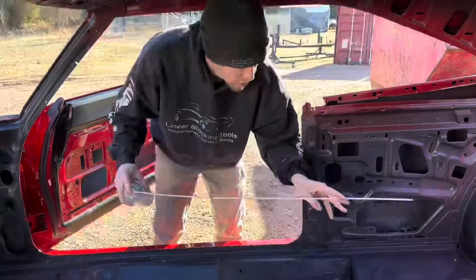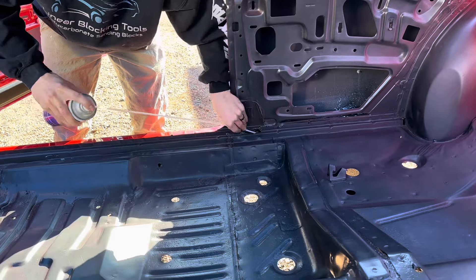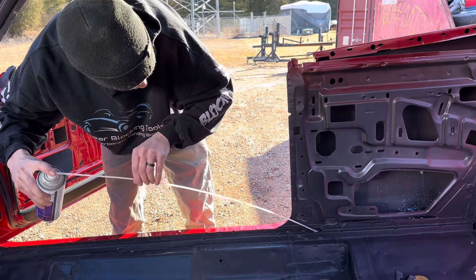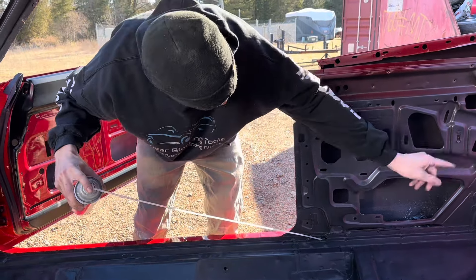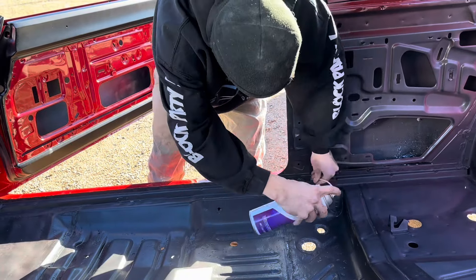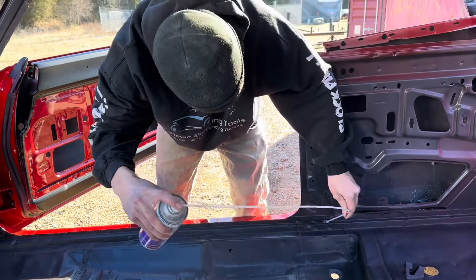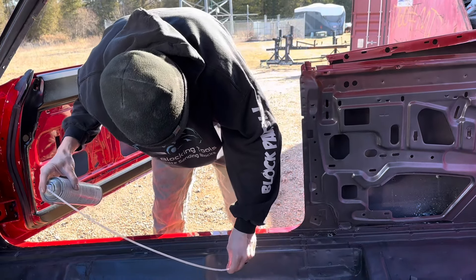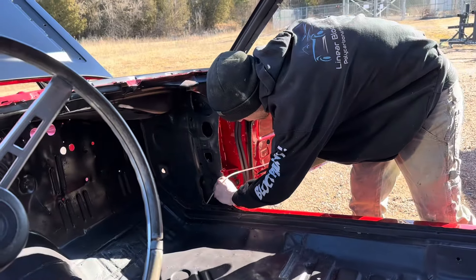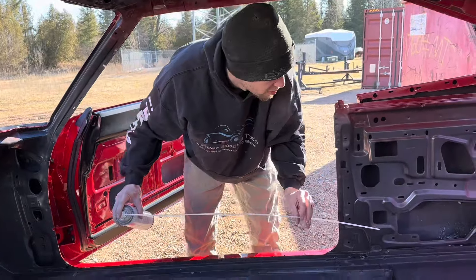With these wands, the whole purpose is that I can find really any hole and stick this in there. I can get all the way to the back of the rocker, then start spraying as I pull this out — it coats that whole rocker 360 degrees. Pretty much any access hole is a good option; you can go in the seat belt hole and get into the rocker, up in the pillars, and get down in there a little bit.